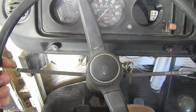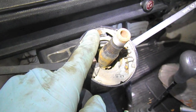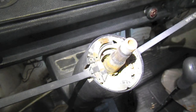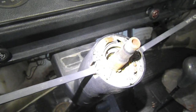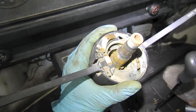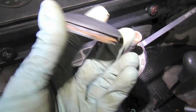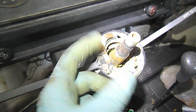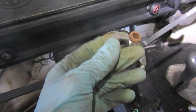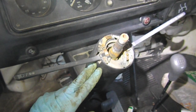It locates center perfectly — man, super responsive. So I'm stoked. I removed the steering wheel and cleaned up the horn contacts and all the functions here, so now we're going to reinstall the steering wheel. Just a quick tip: this is a '75 or later column — the horn button just kind of pops right out. It's super easy, you just use a screwdriver and gently pop it out. Then there's a nut that seats on it and you just pull the steering wheel straight off. So I'm gonna go ahead and put the steering wheel back on and we'll be all centered up.